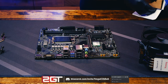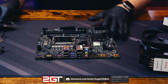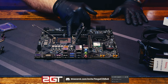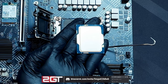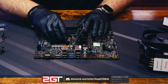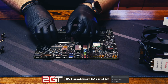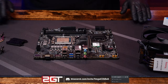Let's get our CPU in — this is our i5-13600K. To open the socket, push down on the bar and move it out like this, then pop it up to reveal the LGA 1700 grid. The chip only goes in one way — there are notches on the edges and you simply cannot put it in the wrong way, so don't try. The secret to computers: if it doesn't go in right the first time, don't push it harder. Once it's nicely seated, drop the cover down and push it — a piece of plastic will pop up, which is normal. Push it down and it's retained.